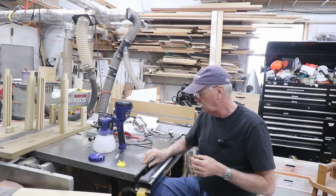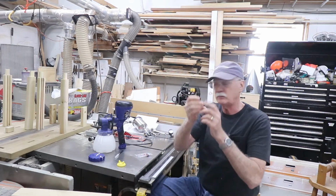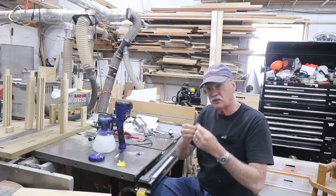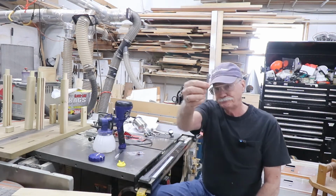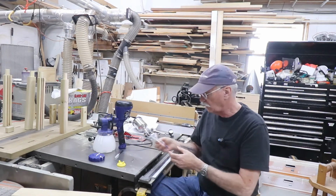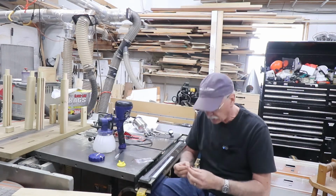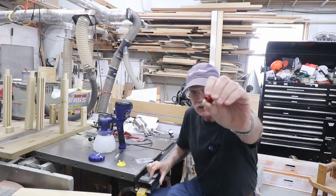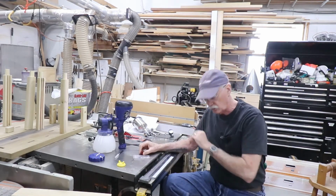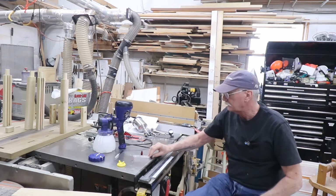More on that later. Comes with a teeny little wrench, 9mm. That's a 9mm for the orifices, and then it's got little wrench bits here for taking the needle caps off. So you can change the needles along with the orifice, because the orifices have, no, I spilled on the floor. I'll get them. The orifices have different sizes, and the needles are matched to those sizes. So let me pick up my parts here off the floor.